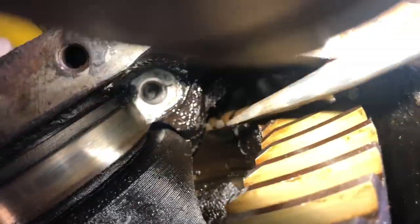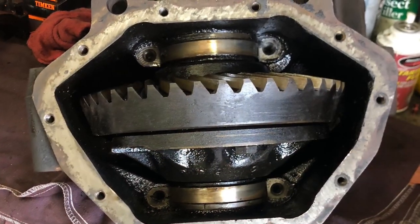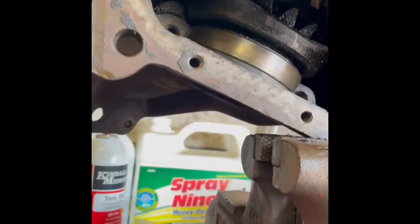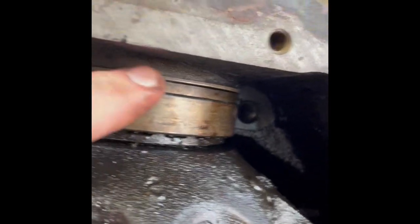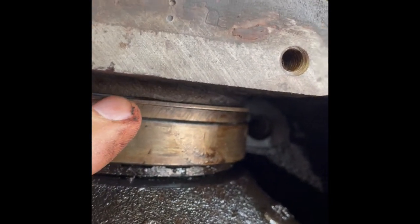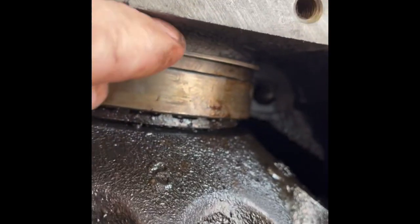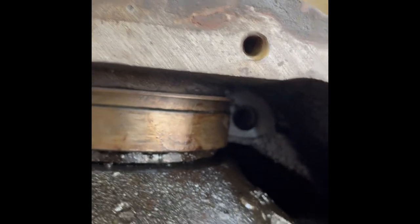There's a big nut in there — I can't get a socket down in there. So even if you get this loose, that thing's not coming out because it hits that. The problem is this will not slide out once the caps are off because it catches up inside there on the ring gear. So what you have to do is you have a spacer and a shim. You have to finagle this little shim out — the spacer will not come out because it catches the top of the bearing. So you have to slide the shim out at the top here, and you have the exact same setup on the other one. Once you get the top shim out, it gives you enough wiggle room to get the bottom shim out.